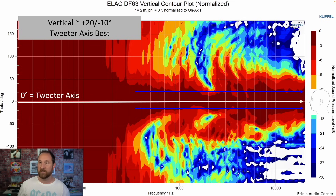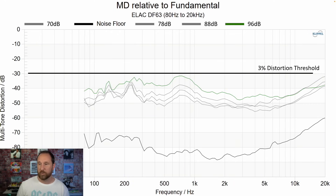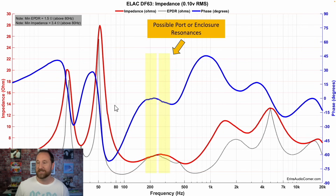Vertical is certainly going to be worse, so you need to sit right on that tweeter axis. Harmonic distortion at 86 dB and 96 dB both look quite good. Multitone distortion is below my personal 3% threshold. With an 80 Hz crossover it does lower the mid-range a little bit through that region. The short-term instantaneous dynamic range compression check looks quite good overall — some scatterings through the lower mid-range region, but still below a decibel. This is pretty good output capability. The group delay shows a dip and then a peak, indicating the resonance we've discussed. The impedance shows a couple of little blips through the highlighted area, also indicating a resonance. Minimum EPDR is about 1.5 ohms — if you're driving this with an AB amplifier, just make sure it's well ventilated. Minimum impedance is about 3.4 ohms, so most 4-ohm amplifiers should be able to drive this speaker pretty well.